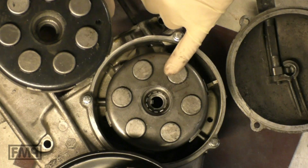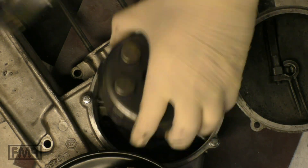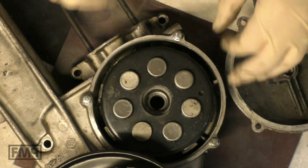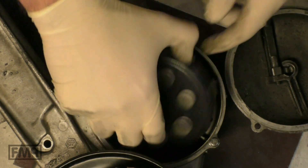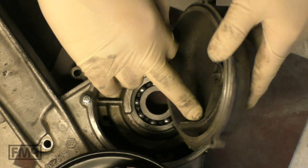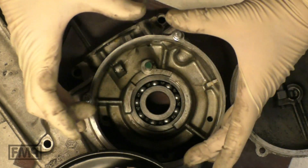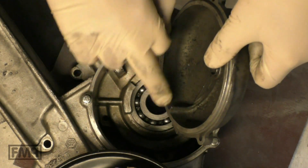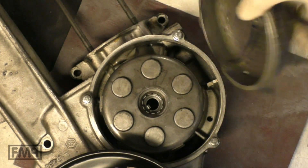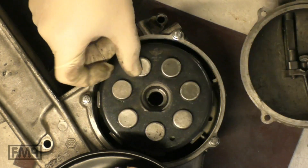I'm gonna get a big clutch now — that's the PX old 6-spring, that's the PX old 7-spring from 200. LML 125 also have the bigger clutches in. You see that diameter got bigger, and this beam had to be shortened because of the tabs coming out here, and also in the clutch cover the beam got smaller. And when we now use tuning clutches which are CNC machined, or they have a ring, they're even bigger. That means we have to completely remove this structure, and the initial idea from the 125 engine to guide some oil to the pressure plate and push rod does not work anymore, because the clutches got bigger.